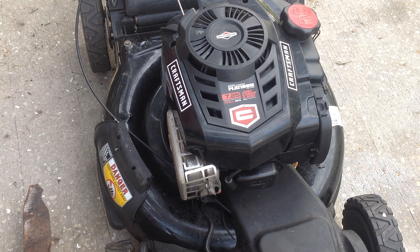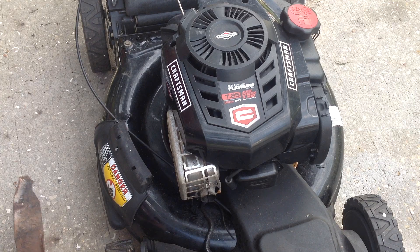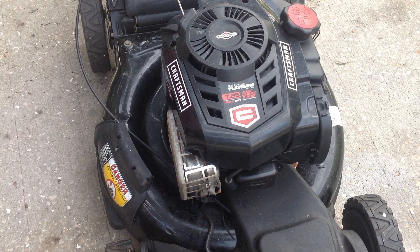So this thing had some issues and I went through it today — let's discuss what I found. First off, I did a carb clean. The gas in the bowl was varnished and the jet was plugged up with snot, so I flushed out the tank, put the carburetor back together, and put it on.